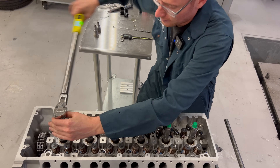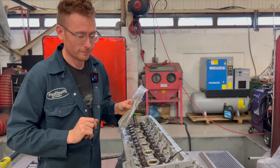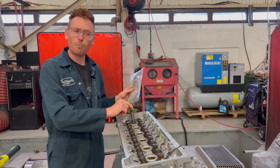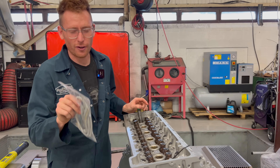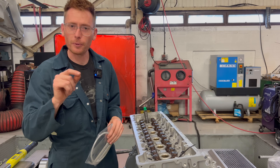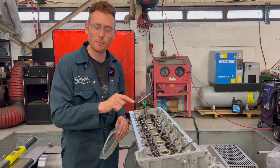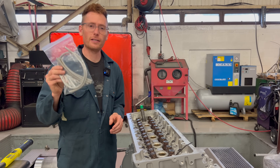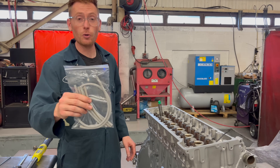For the injector return line, only use the genuine stuff — it's made by Continental. That cheap black stuff from motor factors doesn't seem to last, it pops off. I've also seen people using tygon fluorescent tube, the kind you see on remote control cars — that is garbage, throw it in the bin. Use proper braided diesel-rated hose. It generally lasts 20 years, so it's a good purchase.